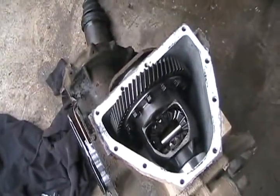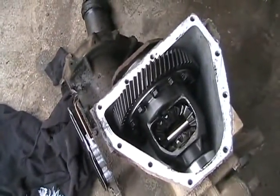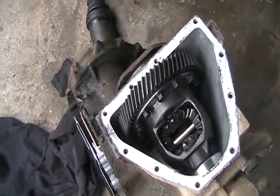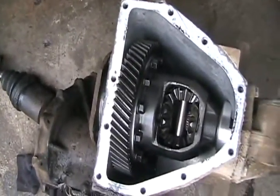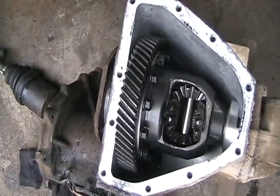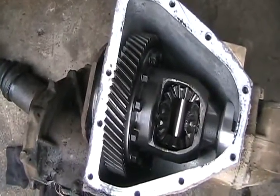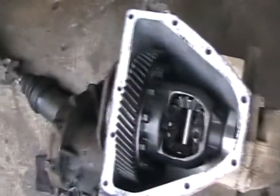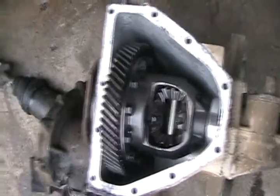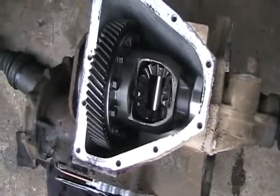Now, how this works: when the transmission is moving and driving, that big gear assembly and the pot behind it — everything is turning at the same speed. When you're driving and turning a corner, the outside wheel always has to travel a larger distance, so it spins a little bit faster. The spider gear area starts to spin so it can give a slightly different speed to the inside axle than the outside axle. If one wheel happens to go into an area with low traction, it might start spinning really fast while the other one could be barely spinning at all.